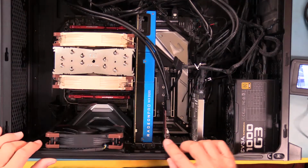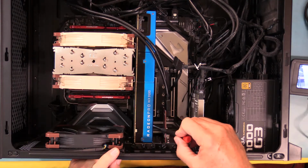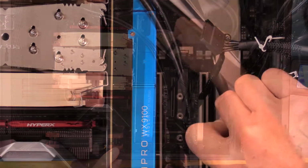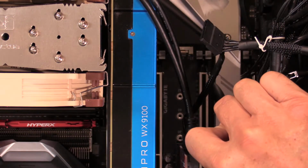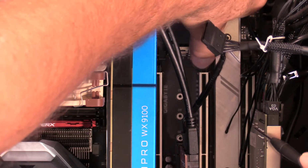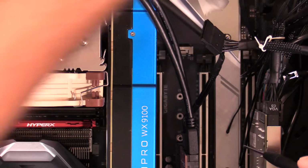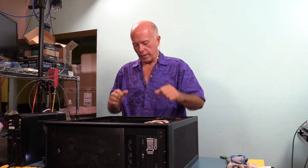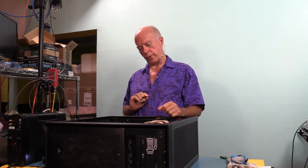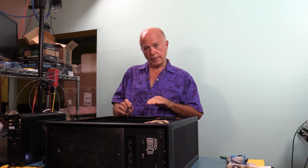Okay, the overhead shot, what we're trying to do is to get down in here. And you see this video card takes up 2 lanes. Because it takes 2 lanes, we're trying to look at the hook, this shoe that locks these cards in. Now, when I flip that down, that's fine. But when you put a card in, that flips up and locks. And you can't pull the card up no matter what. You've got to reach in there with a screwdriver and slide that lock open. That's what we're getting ready to look at to see if we can look underneath there.